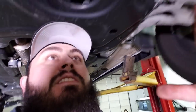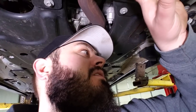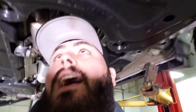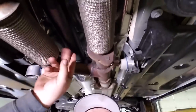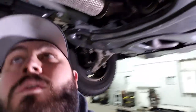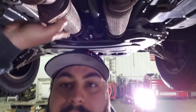This is the V6 model, so underneath me here is the engine, and the transaxle and transfer case are kind of all made into one, with CVs going out on each side and then a mile-long driveshaft. You can kind of see the driveshaft here — it's about a mile long. One thing I thought was kind of neat: this thing is true dual exhaust coming out of the V6.